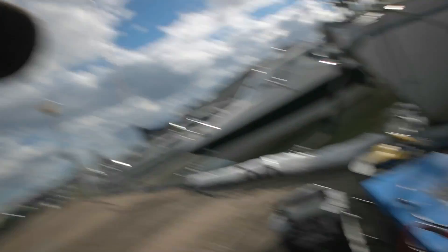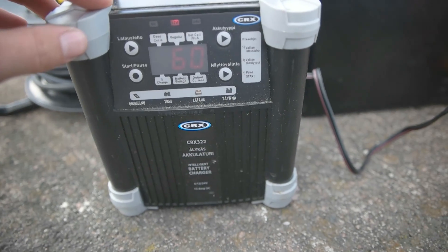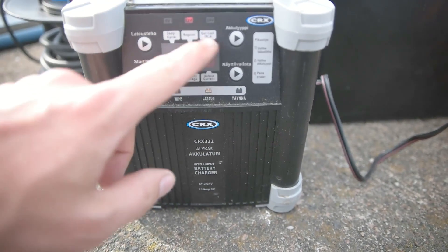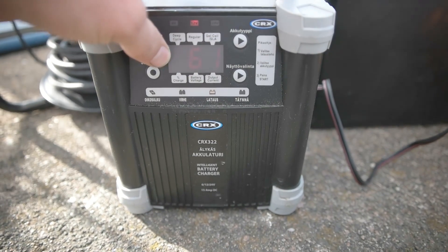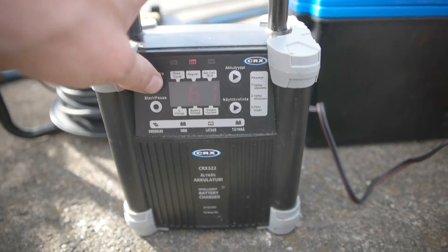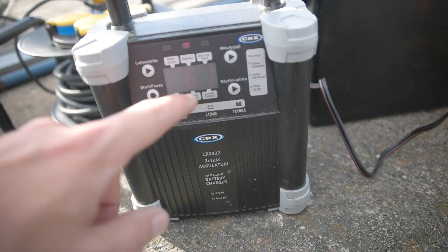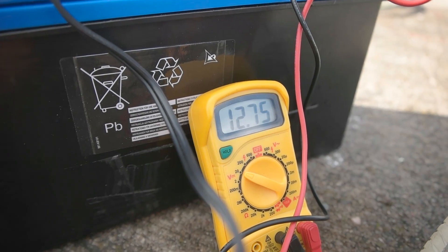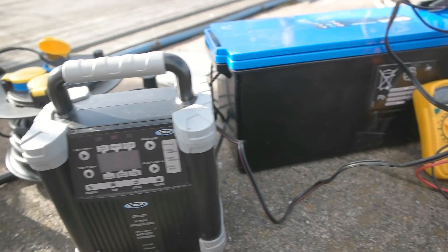So I'm gonna open up a can of beer. The charger just beeped as an indicator that it figured out it's 12 volts, and it's now showing the voltage but also the percent of charge — which I don't really trust — but it's 61 now, and it was about the same with the sister battery when I charged that. The voltage was also pretty similar, and now it's charging at 12.7.